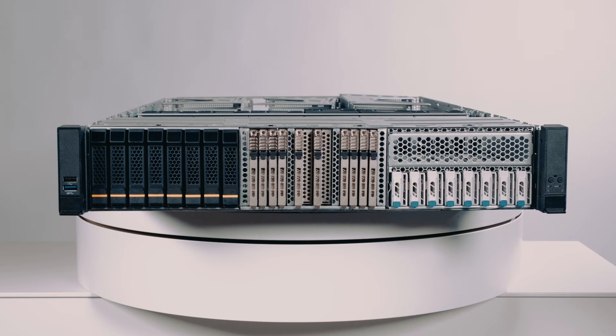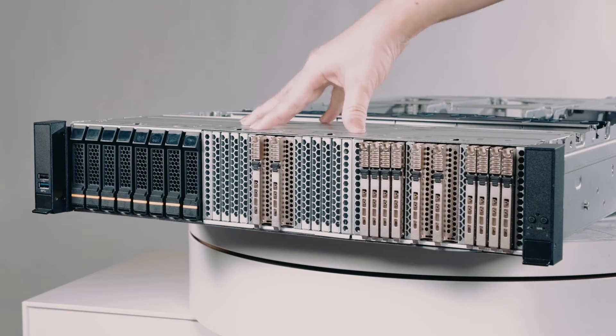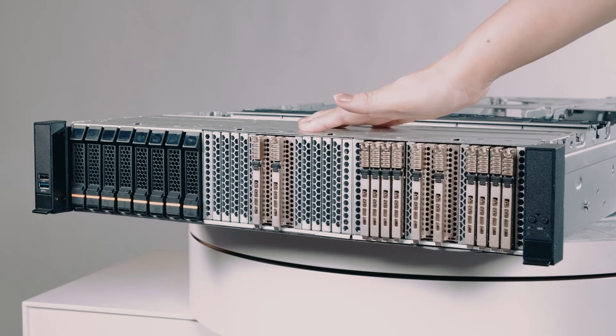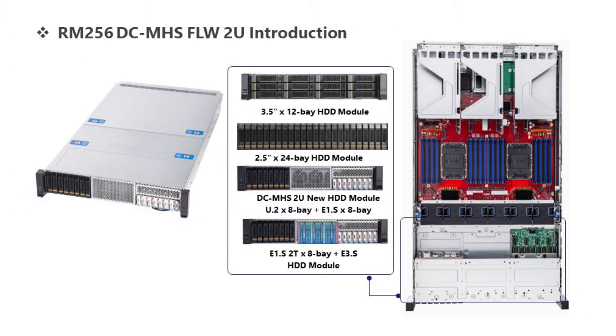But the real star of this generation is our new innovative module. This HD module is actually made up of three small squares. You can mix and match how you want to place your drives in the left, center, and right slot. For example, you can go for right and center with E3 drive modules, and place U.2 modules in the left. Moreover, in the same HD cage, you can create combos like U.2, E1 drive, and E3 drive modules. This means when you need an upgrade or switch SKUs, you just need to swap out the front modules — no need to buy a new cage or even a new chassis.